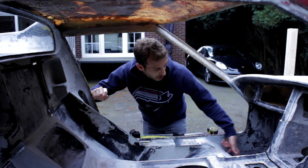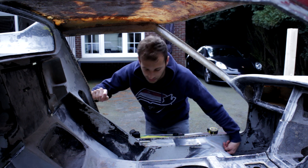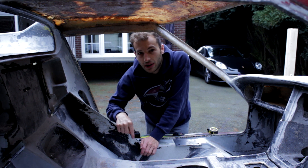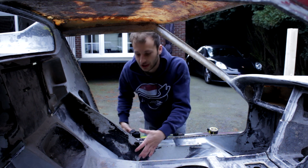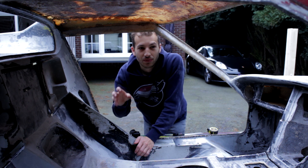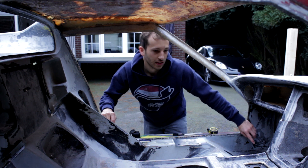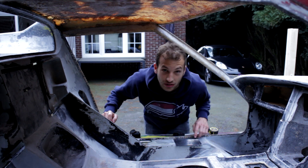I had to drill a couple of holes — one here in the front in the seat base, and one in the bulkhead. In the bulkhead there's also the mounting point for the seat belts, a really big steel plate completely sandwiched in between layers of fiberglass in the sill and bulkhead. I had to use a big hole saw just to drill through the steel plate. So the sill bar goes from here to here to the bulkhead, and then connects with two bars to our mounting plates on the chassis.